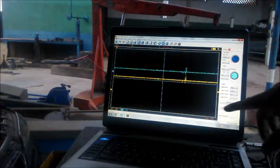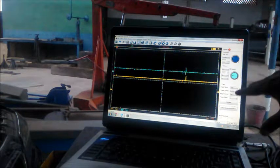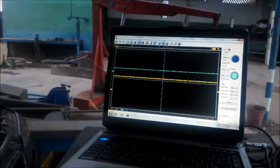the engine control module increases the fuel injector pulse width. In other words, from the APP, it discharges more fuel into the engine, but there is no corresponding increase in the amount of air going in, so the RPMs don't go very high.